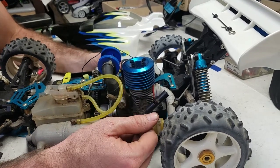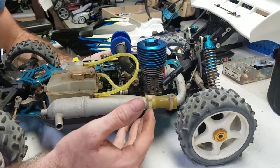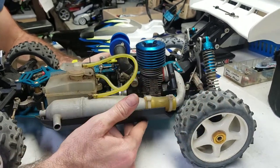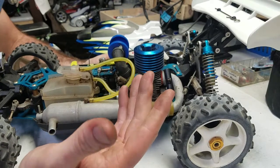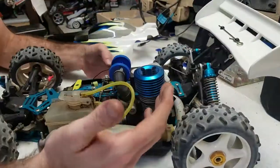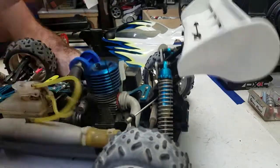Box starters are a little bit less common but still around. Racing cars almost always use box starters. This was more of a club racer, so there were more user-friendly RTR versions of this buggy available that include pull starters. More serious racing engines would not have included a pull starter — this one does, so we're going to use it. Give the pull starter a pull — it should have enough resistance that if you pull it quickly, it can pull the car up off the deck. That's a good rule of thumb. Beyond that, it's an intuition you'll have to develop as to whether the compression feels correct.